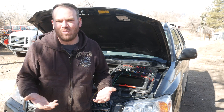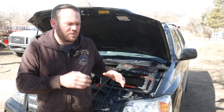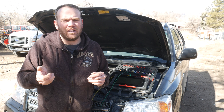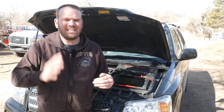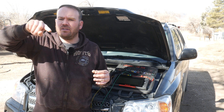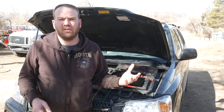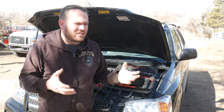It's not something I can do on this hybrid vehicle because they don't give you a whole lot of throttle response. But on a normal vehicle where you can snap the throttle, what you would see if we were scoped on that line — when you snap the throttle, you're going to see a very large jump in the mass airflow sensor voltage, or frequency if we're doing a frequency style mass airflow. Because when you open up that throttle body, even though the engine's not pulling in a lot of air right now, you're filling the void — the intake is under vacuum. When you snap that throttle, a big rush of air jumps in and wants to fill that space. So we see a big rise, then it drops back down, and then it's going to slowly taper up as we race the engine higher and higher.